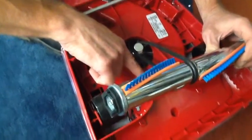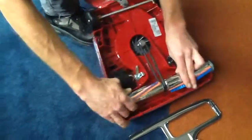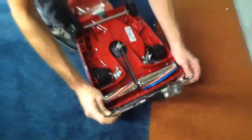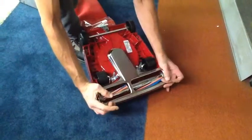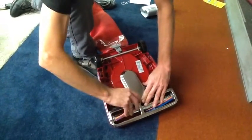You'll see there's a groove on the base. If you drop the lower end of your belt to match that groove, you've got it right. Line up your brush roller, flat ends up, slap it back in, and make sure it's tight. Take your sole plate, grab the tabs on the front, drop it back down, press, and lock. And you're done.